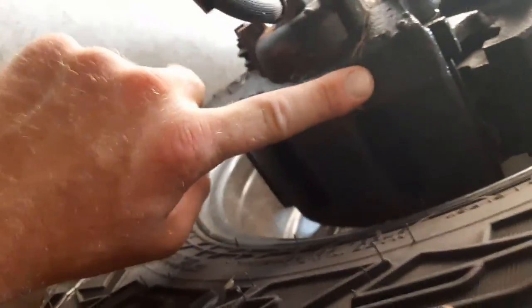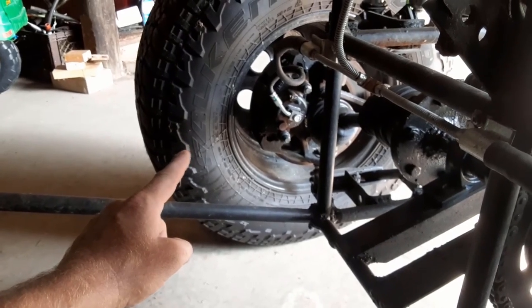The brakes, I just did a pedal that comes with the reservoir, master cylinder, whatever you call it. It pushes it down through the line to a T, and it comes out to our Jeep XJ brakes. And we have a Jeep XJ, that's why we just kind of got some parts that didn't work on this, it'll work on that. And yeah, Jeep knuckles all the way in the front and back. The front, completely homemade axle setup here. Welded all that crap together.